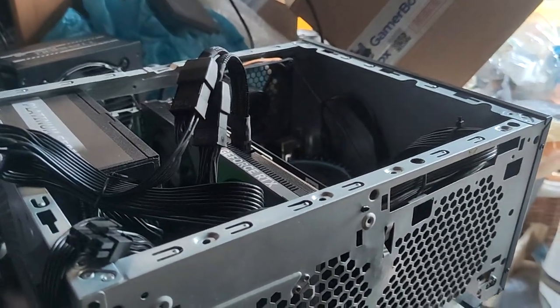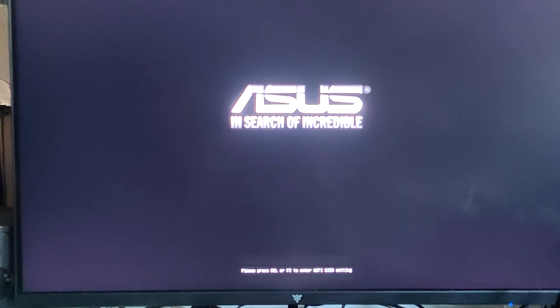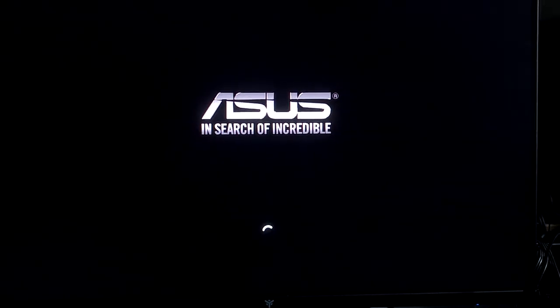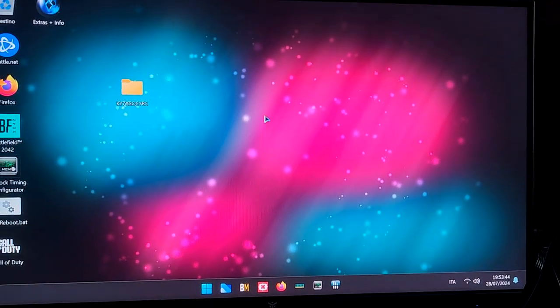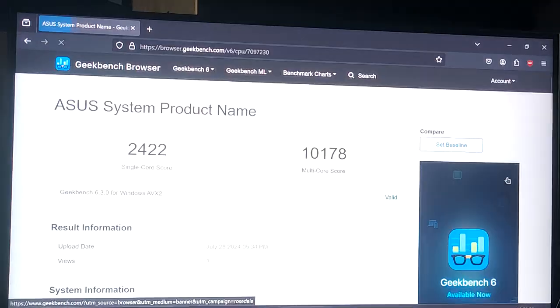And yeah, that's all for the video, I think. So B660M A Prime. If you have this kind of motherboard, you have to check your stepping if you have an i5, and if you have a stepping H0, you could be having performance issues because of the voltage being too low. So you should definitely try to apply a slight positive offset, overvolt, sorry, and maybe you will get the proper scores, for example, Geekbench 6. You can check my scores here.